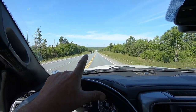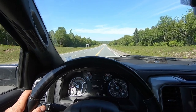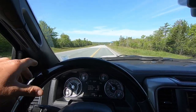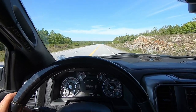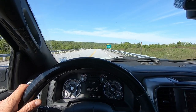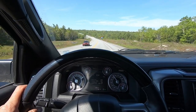There's a really good gradual downhill here and then once it crests it gets steeper. I'm in sixth gear right now — I'm not going to let this thing get out of control. Let's just see what the speed could potentially get up to before I have to tap the brake. I'm pretty sure there's a sharp turn right up here after this hill so I'm not letting this thing get away on me. It did just drop to fifth right there — so yeah, sixth gear is really not needed. For guys who've used these trucks a long time, the second you hook up to a trailer you probably just cancel sixth gear altogether.